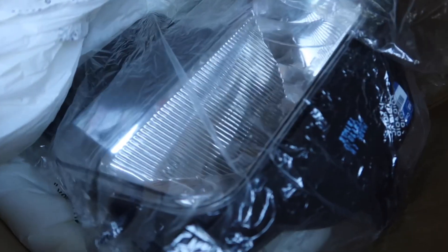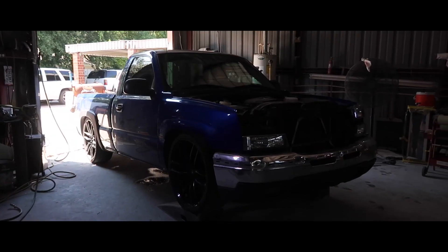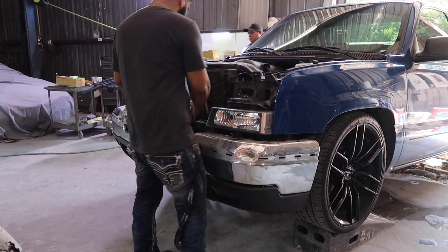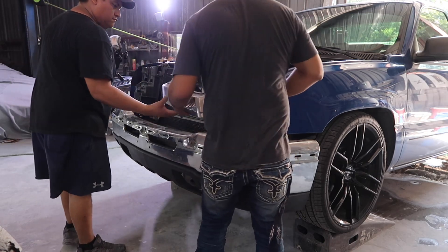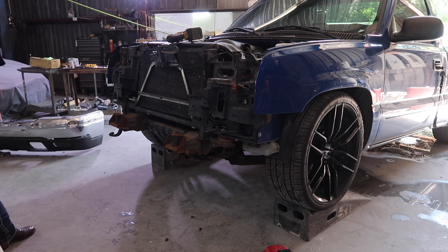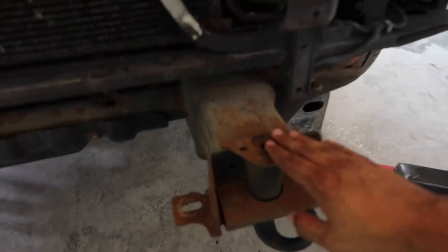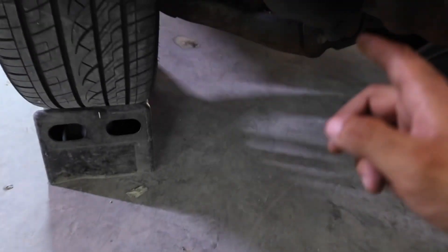We just picked up some more parts for my brother's truck. Got some new fog lights because his are really bad, and I got him the lower valence slip. He was telling me to close the gap you have to put this right here flush with this — so you have to cut it, re-weld it, and put it flush. Then you just adjust those things that go right here to the bumper.